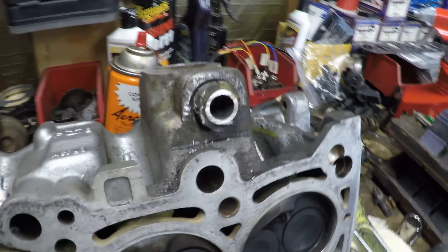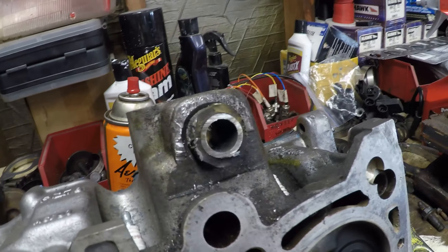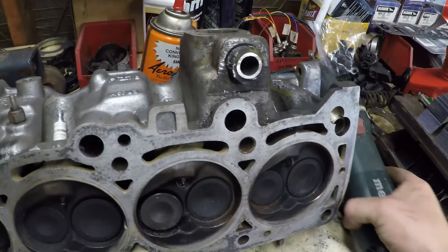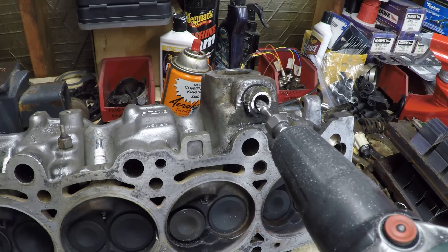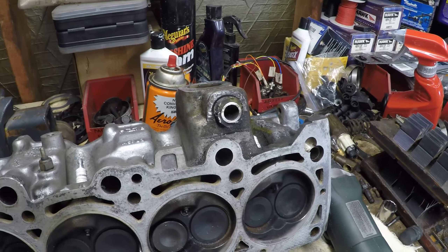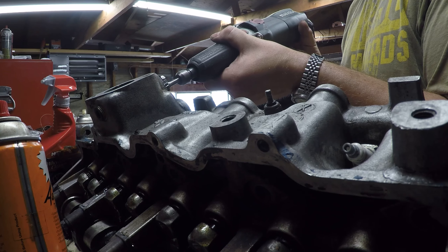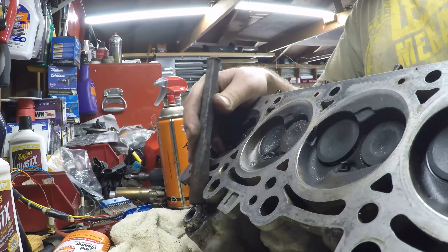Here's what we're left with after cutting off that nipple. If I didn't know better, I'd say there was a little piece pressed into the middle there, but that's clearly not the case. We'll find out when we pull it out. I'm going to take the old Metabo grinder, grind out the inside of this thing, and probably try to crack it so I can tear it up with some vice grips and get it out of there. I've had to do this on a few of these before — it's worth it but it is a pain. Be extra careful if you ever try this: one slip with the grinder, or God forbid the cold chisel, and you're due for a trip to the machine shop.